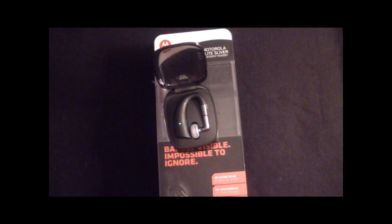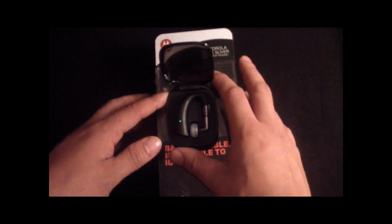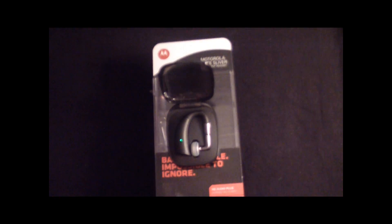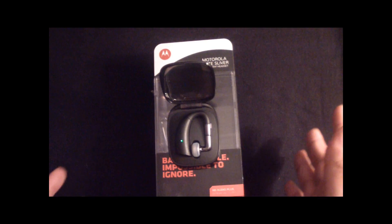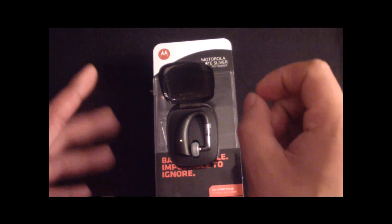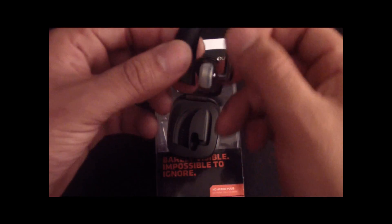A2DP is the technology that allows your music to actually play through it — Bluetooth musical headsets use A2DP. There are two different Bluetooth settings: one for talking through the phone and one for listening to media. On your Android or iPhone it'll say 'media not connected,' but this one has media connected so it works. It also has AVRCP, which is the ability to change tracks, stop, and control volume.